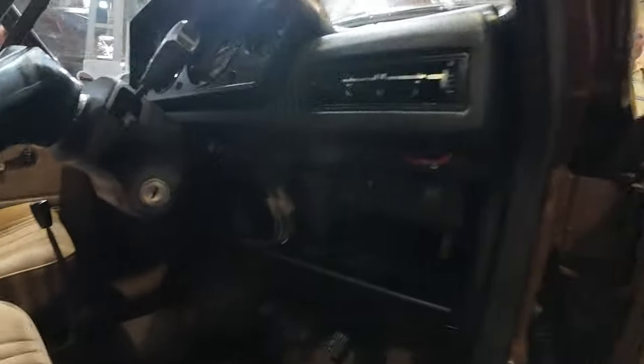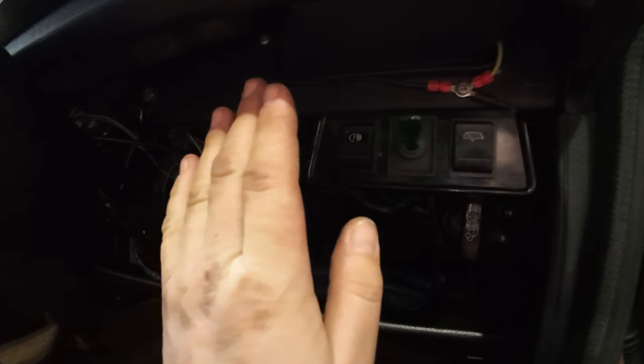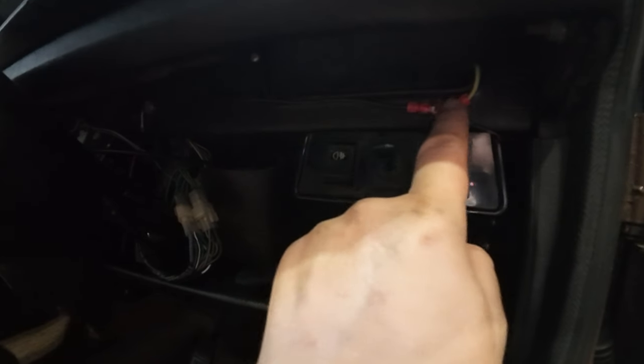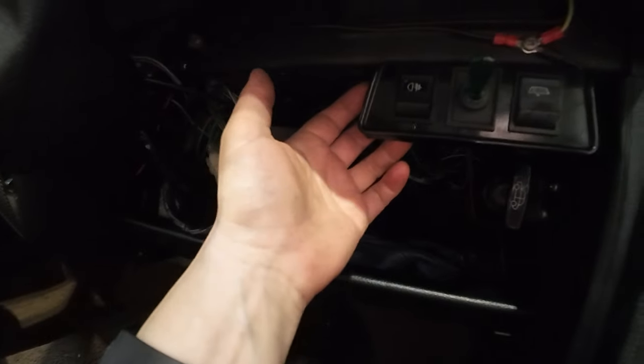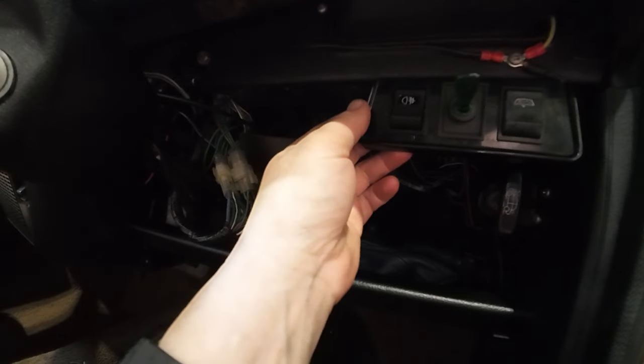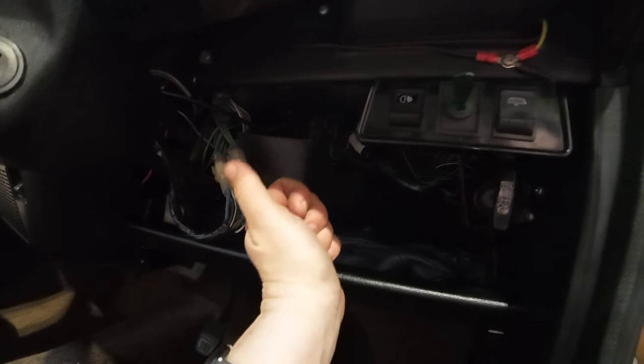We are ready to switch on the fog light, the rear fog. So, switch is in, the bulb seems to be working on continuity test. So there's an earth for the bulb, that I've put here with all these other earths that are randomly here. The live is in the plug with the live from the headlights and the cable for the fog light.